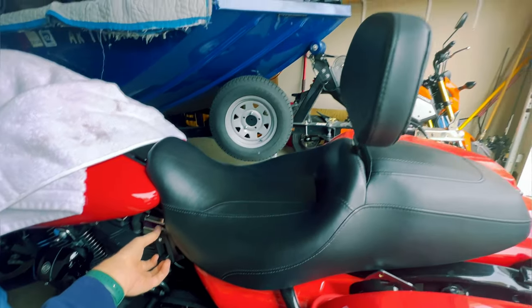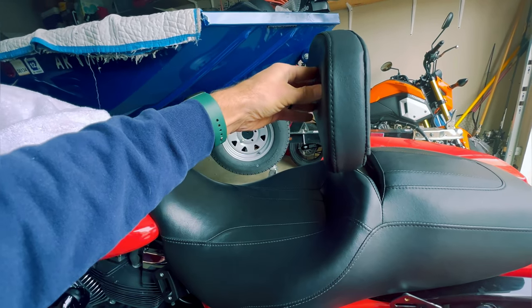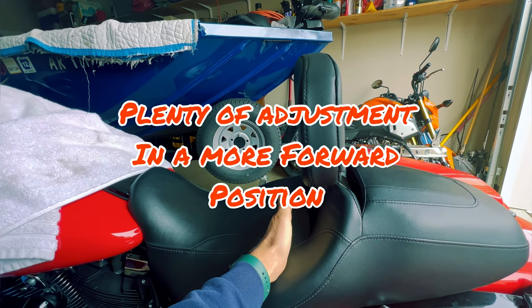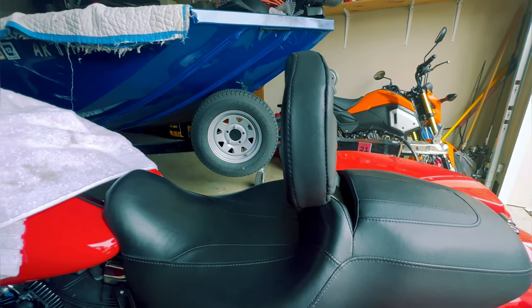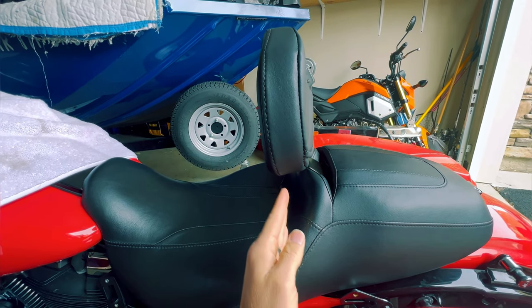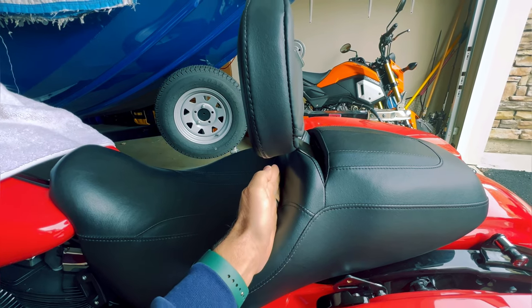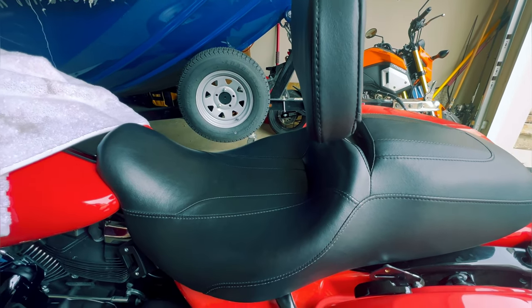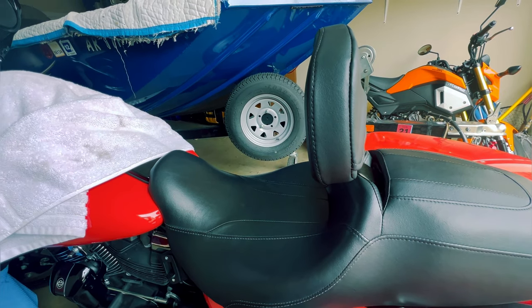Let me pull the lever over here on the adjustment so you can see — that is all the way forward. When it's all the way forward, you can move it down so your passenger can get on easier, especially if you throw a tour pack on. That's your all-the-way-forward position, which puts you sitting way up here. Now if you're short, that's probably fine, or if you want to kind of lean back and stretch your back out. It goes from all the way forward to all the way back where you can get it off your back, versus the factory mount where you can go from here to the back of the seat and never get away from it. So that's the install and the little modification to make it more comfortable for a taller rider or for anybody that doesn't want to lean against it the whole time. Hopefully that gives you some insight on how to mount the adjustable backrest from Harley, with modifications for better paint protection, safety with the cap, and more adjustment on the backrest.